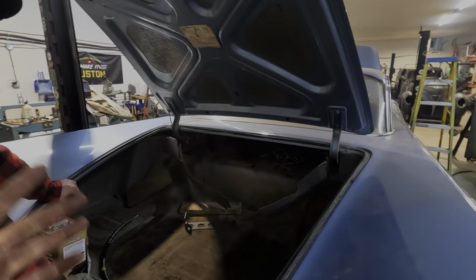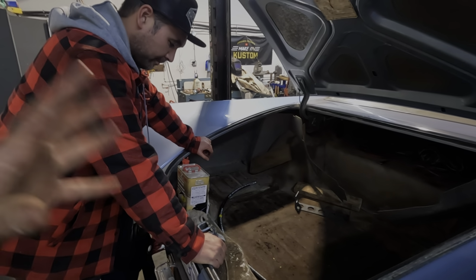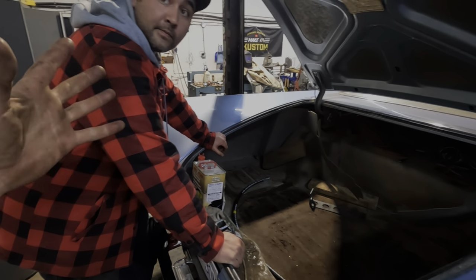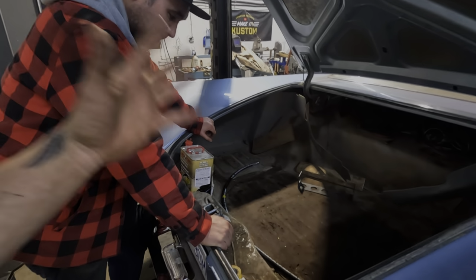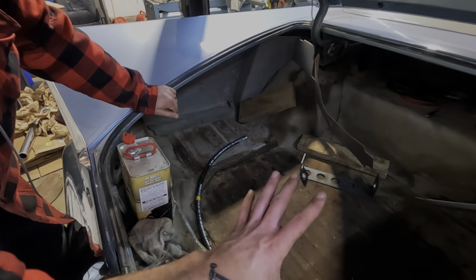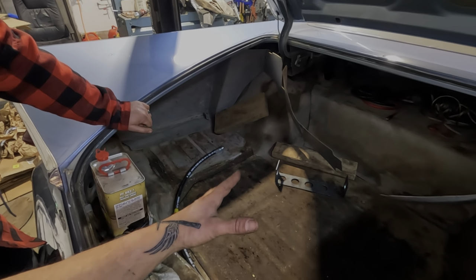Awesome. So rear cylinders are in, they've got lots of clearance, they're poking through right up front there. Front cylinders are in. Basically now it's just wiring. And the pump rack is tacked together, so I'm going to finish the pump rack and get that painted. And then the next time the pump rack goes in, it can be bolted down. We've got a couple of hole marks here, here, there and there. The pads I made for the pump rack are nice and large to distribute the weight because we're not bolting through to the chassis.